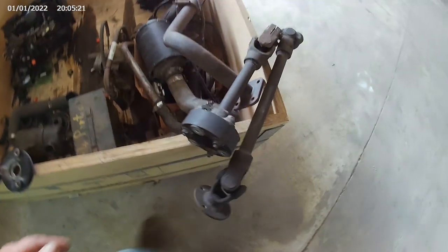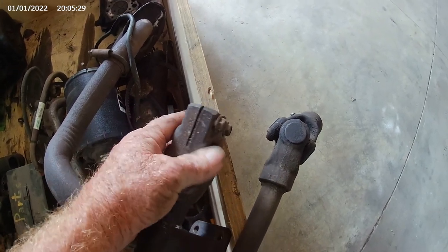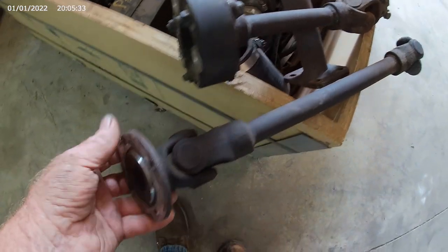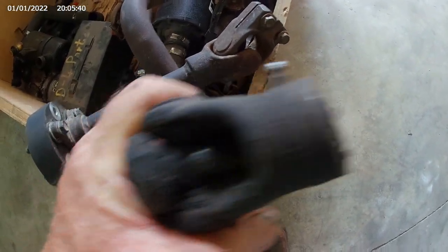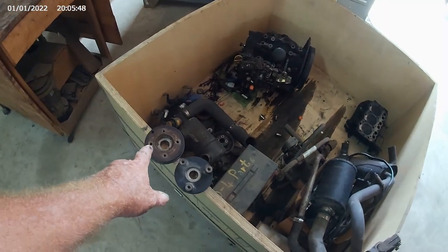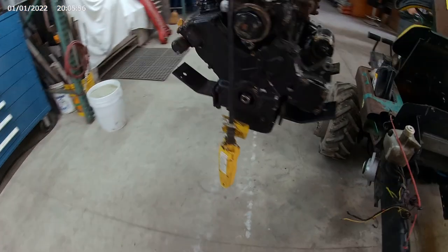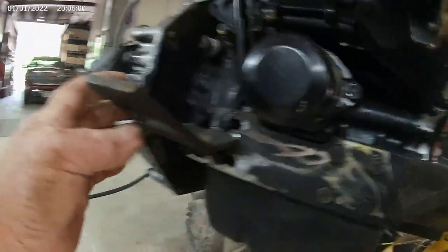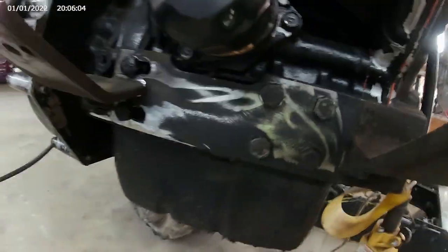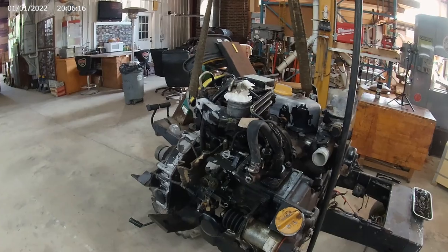What I had to do was — this was the drive shaft that came out of the original with a flex coupling, and on the spline on the hydrostat unit was a cinch. The one that came off the replacement engine is a four bolt with a longer drive shaft, and on the end was a slip yoke instead of a cinch. So now I'm going to have to cut this all apart and change all of this. I'm going to go back with the original four bolt setup. I've had to elongate the engine mount holes too — where the engine sits is totally different. I thought it would be real simple: 3TN and a 3TN. But that didn't pan out.